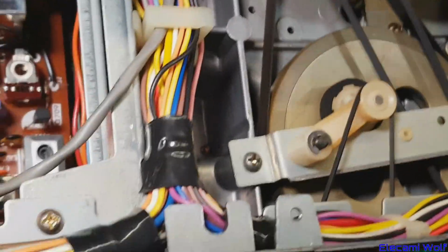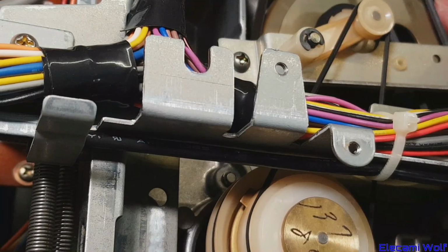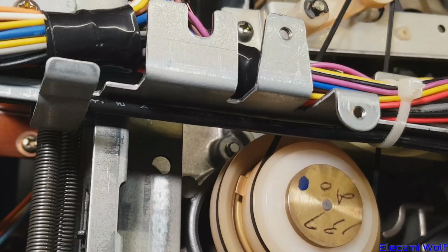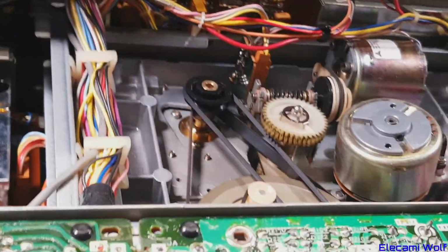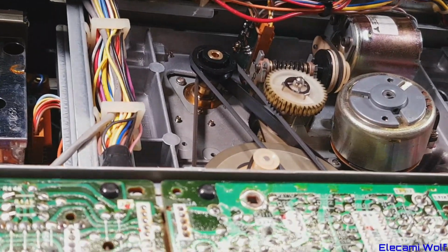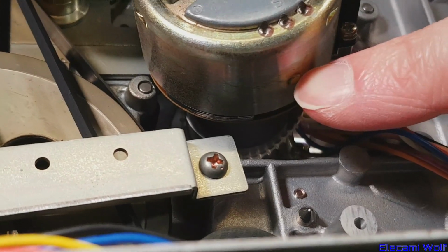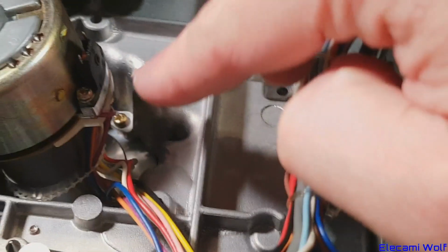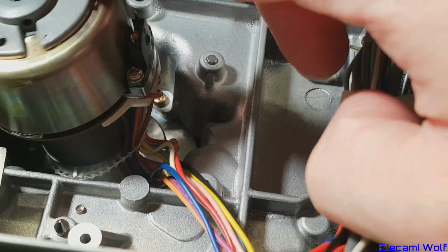And it just looks like that servo stuff. There must be some speed sensing on this. Somewhere there'll be something related to that, so that they can run at the right speed. Maybe it's done by the control head. And there's usually something else. The flywheel probably has a little magnetic thing in it, and then a pickup. That's often how that works. Similar to this, you can see there's a little magnetic thing in the side of that, and then there's a coil there which will be able to sense when that comes past.